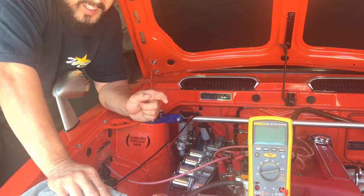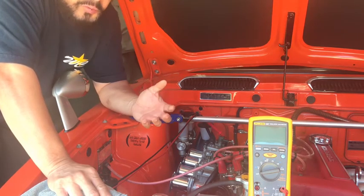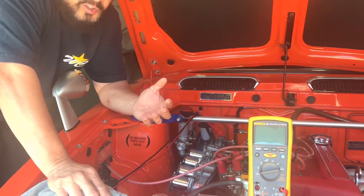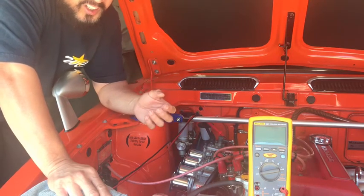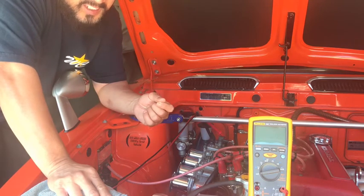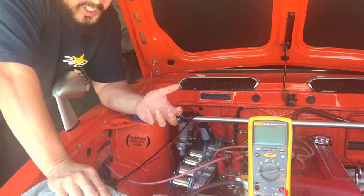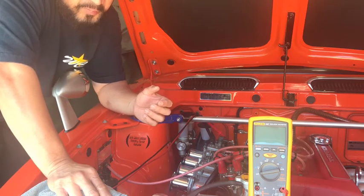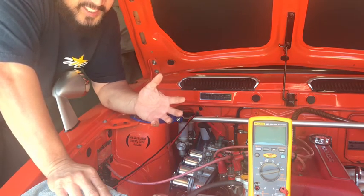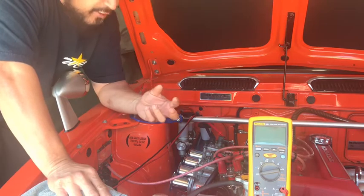So what is this about? The majority of today's braking systems use a combination of dissimilar metals. Manufacturers use aluminum in pistons and housings and steel in brake lines and some wheel cylinders. When moisture mixes with the brake fluid, a galvanic reaction or corrosion can occur. The higher the moisture content, the higher the galvanic reaction and the greater the erosion and corrosion it causes in the brake system. The DVOM galvanic reaction test measures the voltage created by the galvanic reaction due to the level of moisture in the fluid.